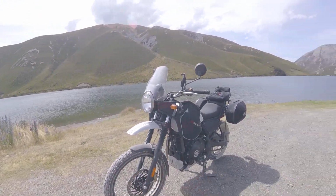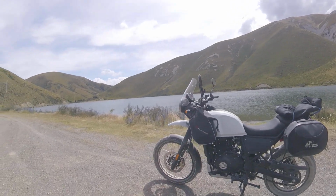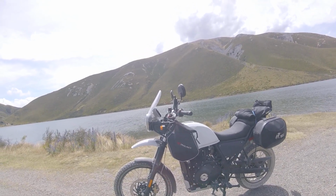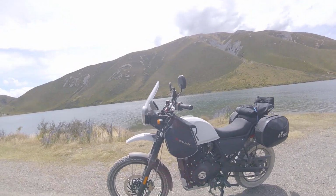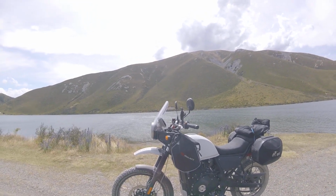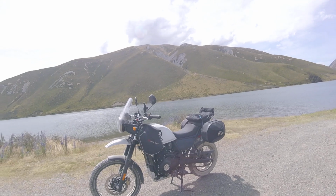But I think it's a really good bike. One of the things that annoyed me the most when I first got it, and it seemed odd, was that when you started it up, you had to warm it up for 5 minutes on full choke, and it got quite hot, as you can imagine, because the engine was quite tight from new. I don't have to do that now. I can virtually turn the choke off straight away, so it's obviously bedded in and freed up.